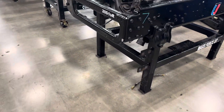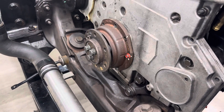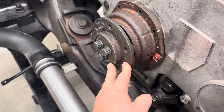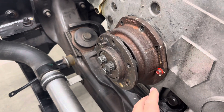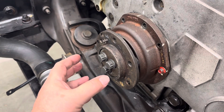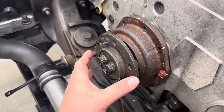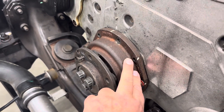I can show you an example of what it looks like when it's installed on the engine. Right here on this MaxForce it's basically the same setup — you've got a hub here that the vibration dampener attaches to. Behind this hub, which you have to use a puller to remove, is interference fit, so you actually have to heat this hub up to expand it to fit back on. Behind the hub is the oil pump housing.